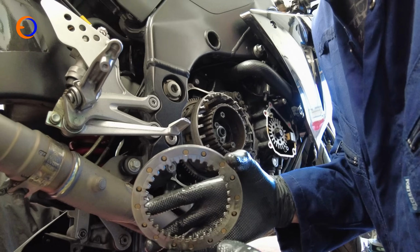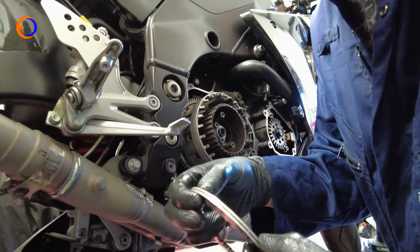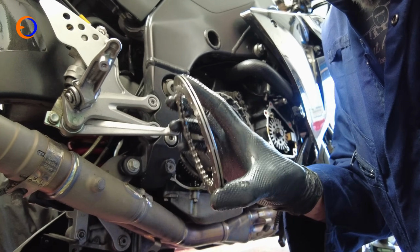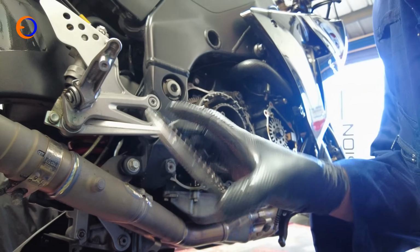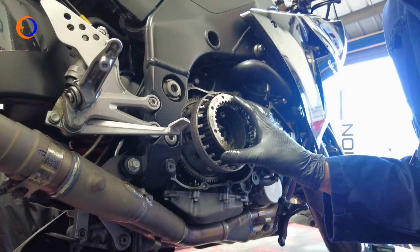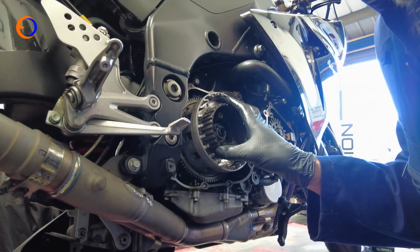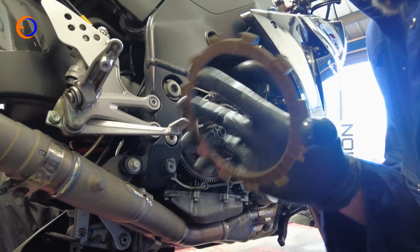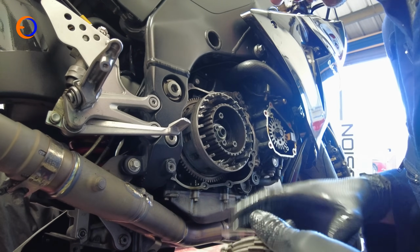At the back of the clutch, there is this special anti-judder plate with springs in it. So basically that means the clutch doesn't judder when you're setting off. So the later bikes, the 06 onwards bikes, didn't get this because it costs more money to make. But it is better. In fact, for the 06 onwards bikes, the 06 and 08, the kit clutch, if you wanted a better clutch, was in fact the standard clutch from an 04 bike. So bit by bit, we'll get this built up.